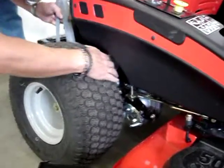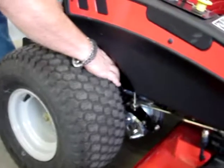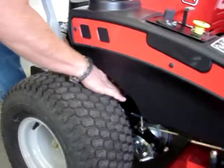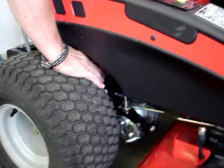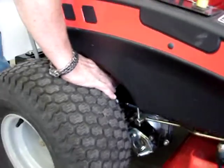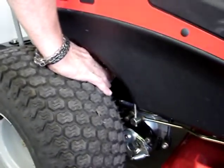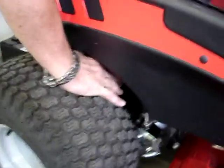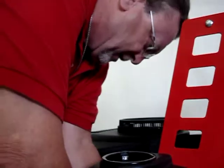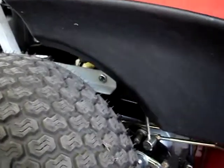It's a little tricky. It's easier to take the tire off, but that's more work than you need to bother with. Place it in there and stick a washer over the bolt, then place the nut on the bolt. The washer is to ensure that you get a lot of torque on that bolt. We don't specify torques — it's a lock nut. You just put it on there snug, real snug. You can put a lot to it.